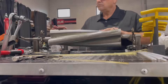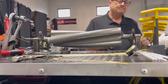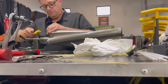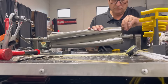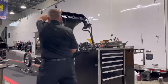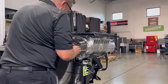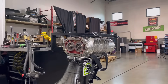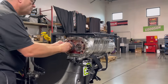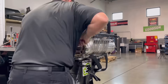I'm kind of anal about these bearings — they go back exactly where they came from. I'm going to sand down the top edges of this OD material because it kind of leaves a sharp edge on it, which can sometimes give you a false sense of the clearance you're measuring with a feeler blade, because it might be on that edge a little bit. So I'm just kind of rounding that seal off a little bit. I'm also putting on the cloverleaves again and cleaning the blower case out. You got to admit, this little carousel that holds the blower is pretty trick — Trick Tools is one of the first companies that actually made this years ago. So I put the covers back on, throw the gear on the front, and give it a quick turn. I can already tell right away that this thing is way too tight.